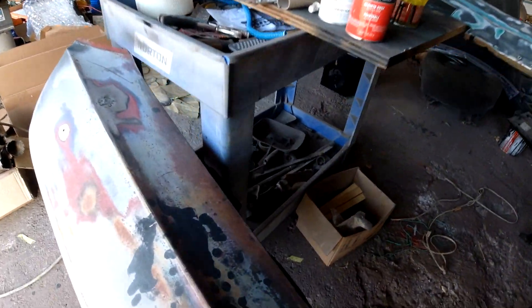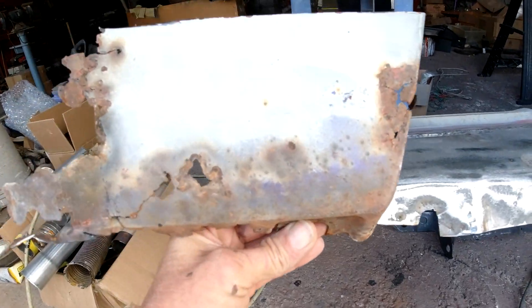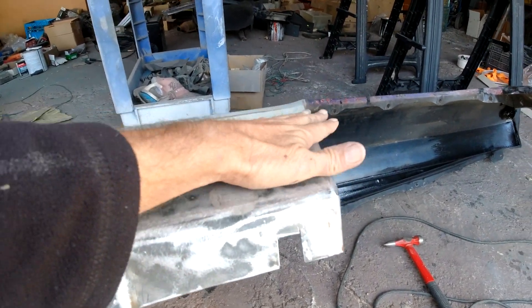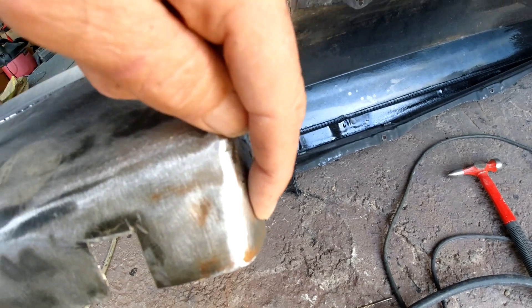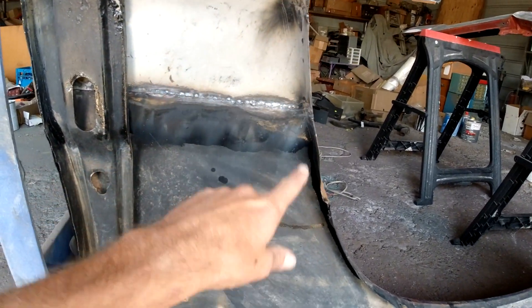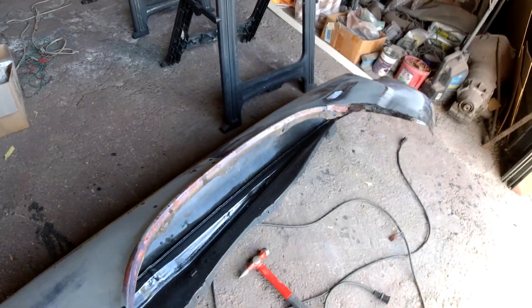The header panel's ready to paint. I did the patch. I got the patch made here on the fender. I'm not going to do any body work to this until it's all mounted — it's kind of warped a little bit in there but that's what Bondo's for. We'll dolly that and fix it out later. I just spliced it in there, drilled the hole for the bolt. That's the back of it. Fixing to prime all the bare metal areas, then put some black paint on it. Put a little piece of metal there to fix the antenna hole.